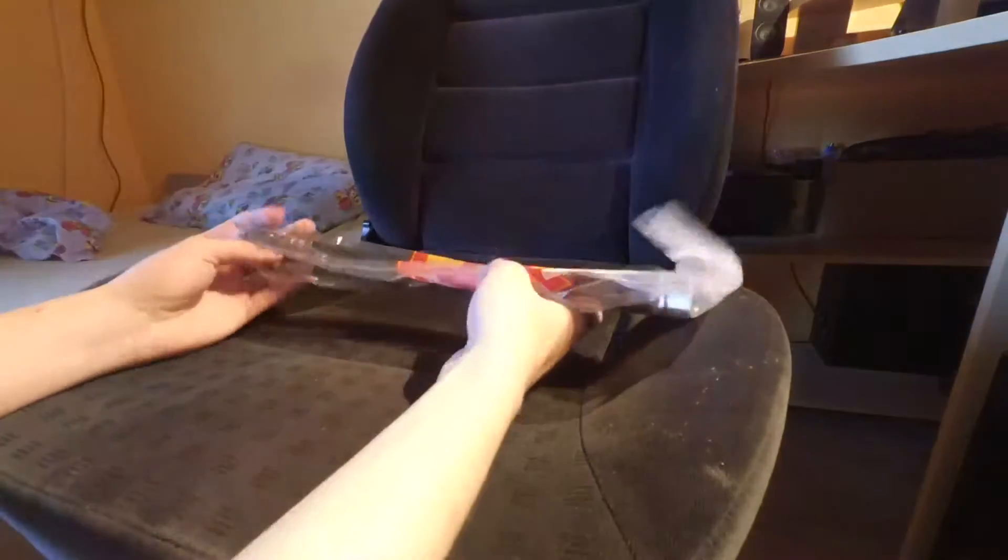I've peeled off our awesome protective film. Now I gotta fix this slide somehow — this is not attached to anything, so that could be something. When it goes up, see it gets stuck somewhere. So yeah, the window goes super high. That's what this bracket is for — you have to put it in there so it stops when it gets to that level. First off I'm gonna make it go down, then I need to put this thing in here like this so it sets in nicely, then I have to put in the bolt. I got this all tightened down right here, kind of center — I think that's where it's supposed to be.